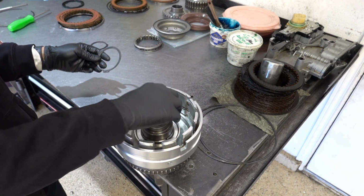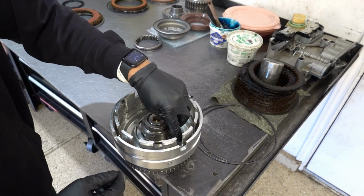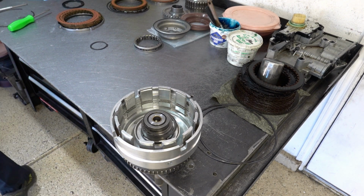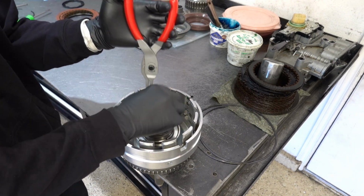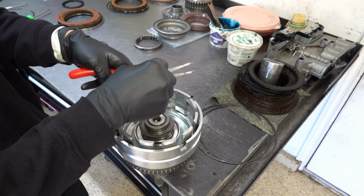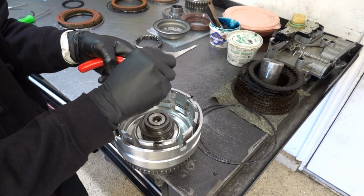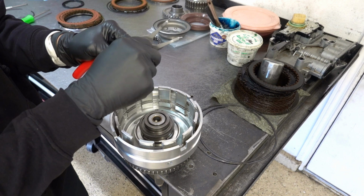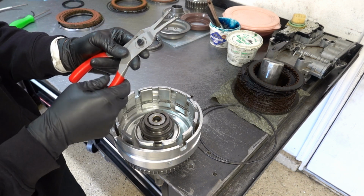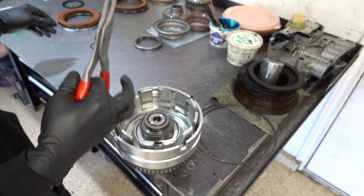So this is the snap ring that's going to go in first. The beveled side, it's a concave bevel that feeds inward, is going to face you. I'm going to get my pliers. It doesn't really matter where it goes as far as the eye loops, and the pliers are not set up correctly. These Snap-on pliers are barely big enough to deal with this thing. And I'll give you the tool number in a second. It's SRPC 9000A. There you go.